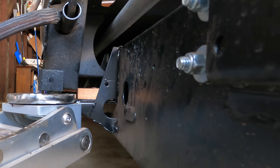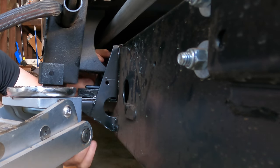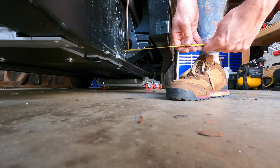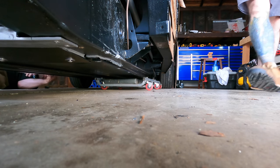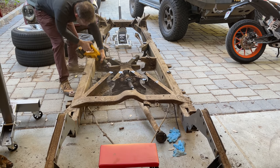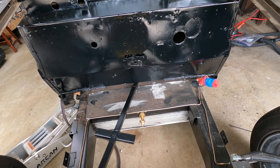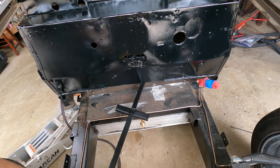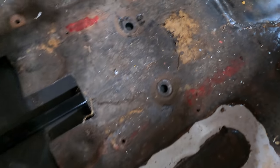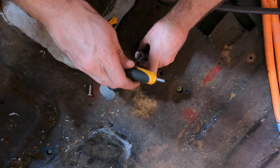I lifted the body, removed the old wood spacers, put new ones in with rubber cushions on top, and then dropped the bolt through. I nudged the body around gently until it was centered on the frame, then torqued all the bolts down. The body is bolted to the frame along the side, but not in the center. This is more involved since I unceremoniously removed the center X-brace that had many of the frame-to-body fasteners. The battery has places for five bolts to go all the way through into the body in the center. I also wanted to pick up four of the old body mounting points, so I welded up a piece of steel with four arms coming off it. The arms stick out to bolt to the body in four places, sandwiched between rubber bushings. Soon I'll need to weld up a frame to mount the seat to, and that will probably attach to these bolts going through the battery.